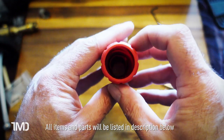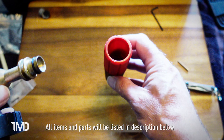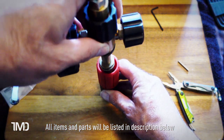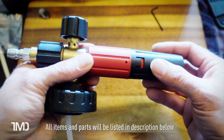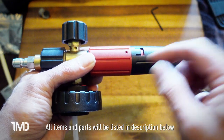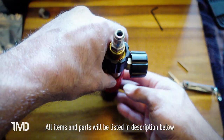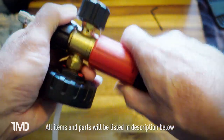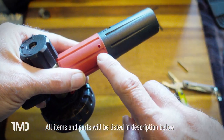With the old filters removed and the new filters in place, we're going to reinsert the nozzle back over the brass nozzle. The best way is to put the plastic nozzle flat on the table and press the brass nozzle down onto it — if you hold the plastic nozzle horizontally, the filters will fall out of place and impede proper insertion. Put it vertical so the filters stay in place, then twist and push until it goes no further.